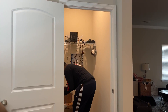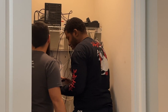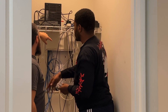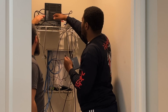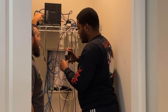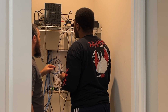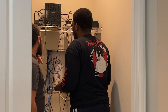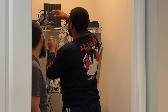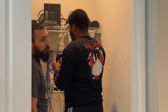And by me I mean Kevin, because he's doing everything. We're going to plug this into the router first, then once the router has power we need to access the BGW 210 and do something called IP passthrough so the ER605 gets a WAN IP address. Then we'll plug in the rest of the stuff afterwards. By the way, we're going to put a rack in here eventually — we're just setting it all up for now, so don't worry about the cables and the mess.